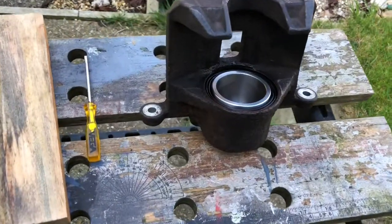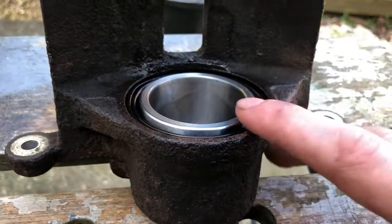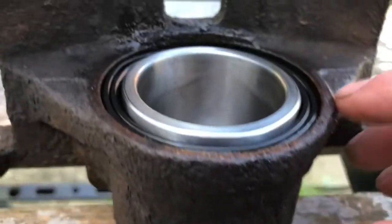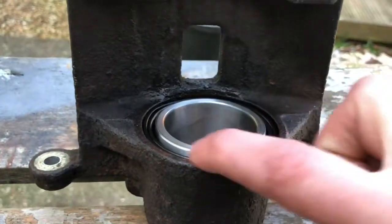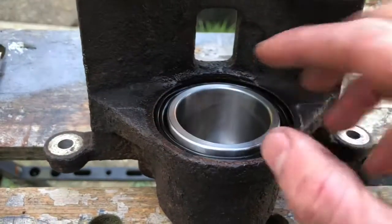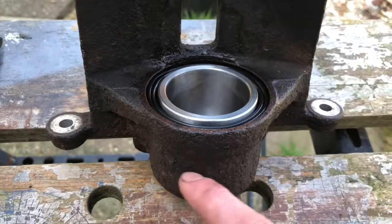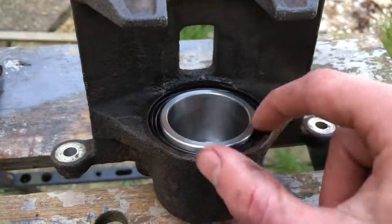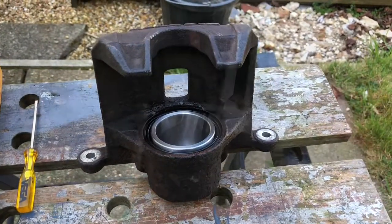You use old brake fluid - in the Honda's case some old DOT 4. It's very lubricating, so put it around the seal and very lightly around the top of the caliper where it sits. Put the seal on the piston up top but then roll it all the way down so the other end of the seal overhangs the piston, giving a bit of sag at the bottom. Gently feed the piston down and all the time you can manipulate the rubber boot around the lip. It's quite time consuming but once it's in it's actually relatively difficult to depress the piston because it's formed an air lock. You need to release the bleed nipple from the bottom and use a wedge and C-clamp to push it back down. After the third attempt it's now seated properly and we can go back to the car to fit it.